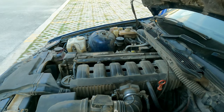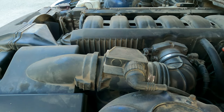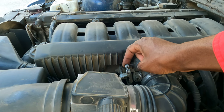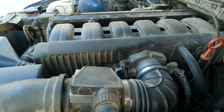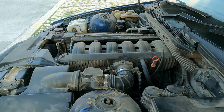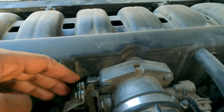Right. One of the things that's going to happen, though, is that when you make this change, that section of the pedal is going to feel dead because you've already taken up the tension here. So ultimately you're going to want to adjust this after that. But if it's a case where you just want to get home and sit at a traffic light without having to do the feathering that you're doing, adjusting this will do that. But because you've taken up the slack here, you have a dead spot here. With this thickness, I'm sure it's not really that much of a dead spot, right? Yeah, I never look at that and think about that. So I'm definitely going to try that, because that can at least keep it on until you get that ECV.